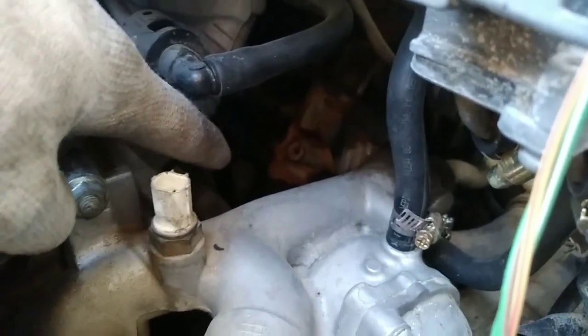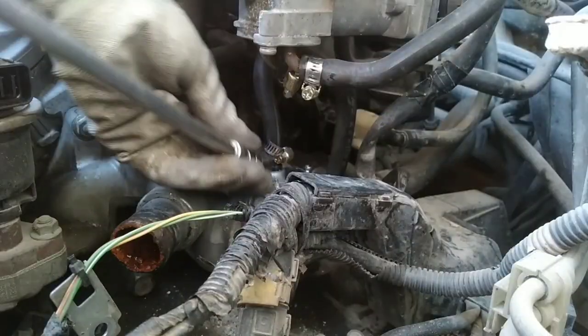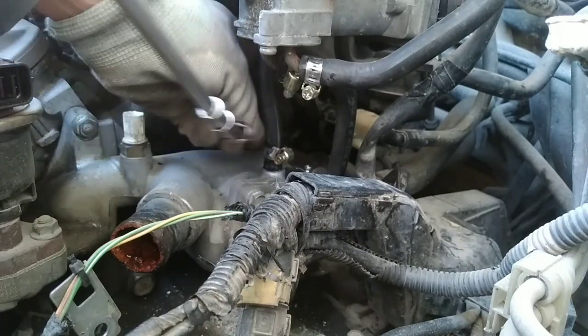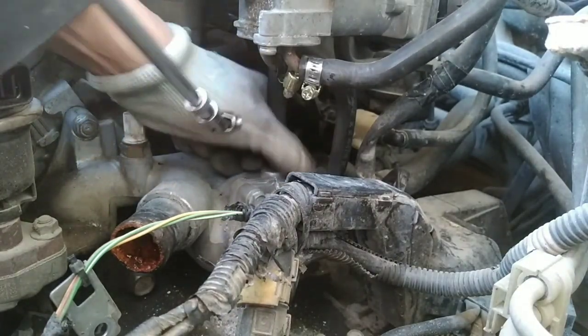We're gonna be taking out the connecting pipe, so stay tuned. We're gonna remove all these bolts. These are size 12, all of them. I recommend you start with the hoses first, so we have a solid piece and then we can pry to remove the hose. This line has a quarter size socket. I'm just gonna be using this quick swivel to take it out.